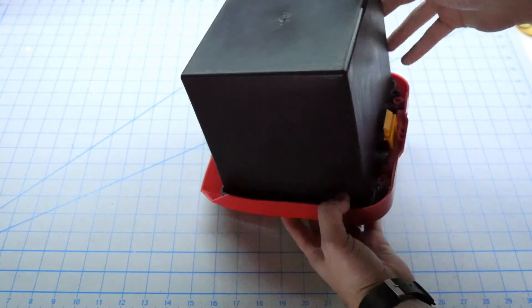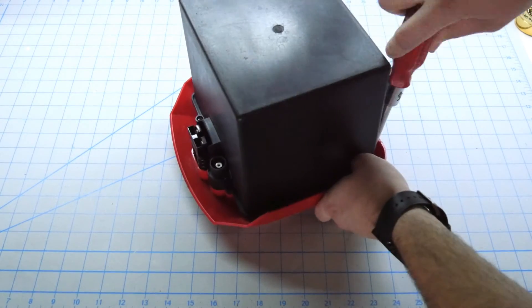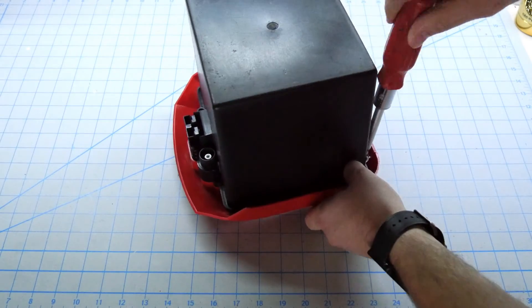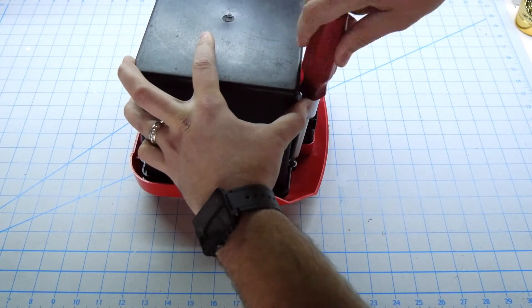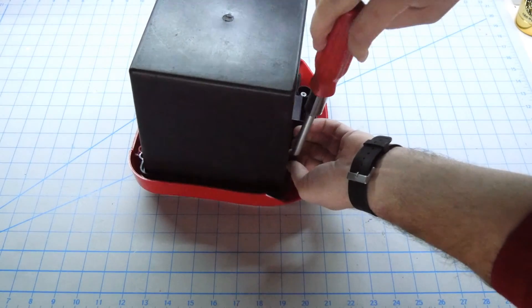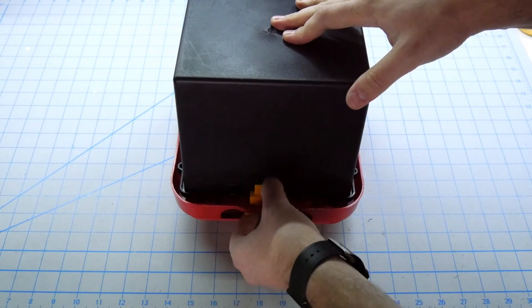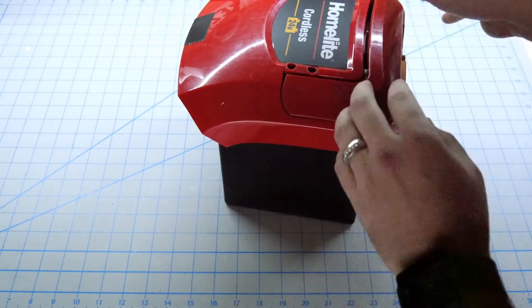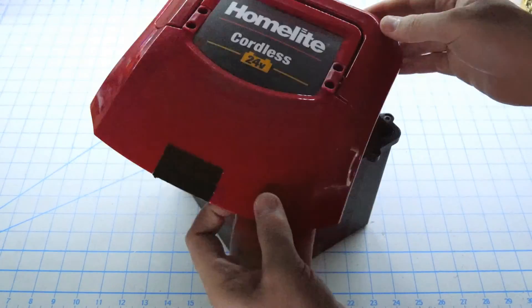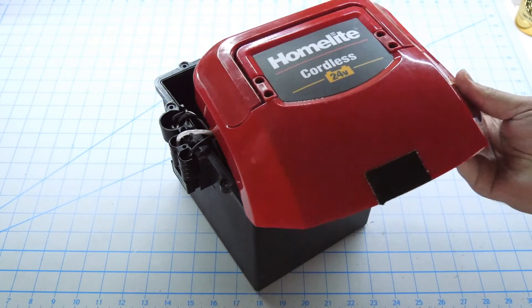Pulling this part is actually pretty easy — there are eight screws that hold this plastic compartment on. I already went ahead and removed six of them, so there are only two screws left to pull apart, which makes this come apart pretty quick. One thing to be mindful of when pulling this apart is that the latch back here actually has two springs on it, so be careful that the springs don't shoot across the room. Mine already has the springs removed. This lid comes off cleanly and is a perfectly fine part to reuse, so I will be reusing it to make the mower look more stock when it's finished.